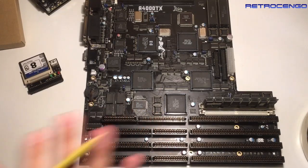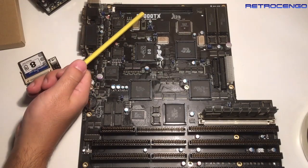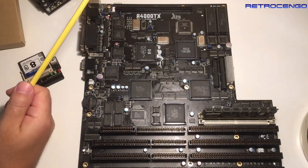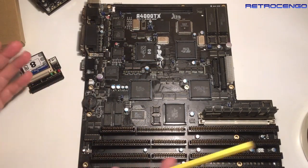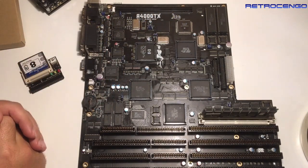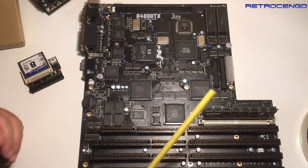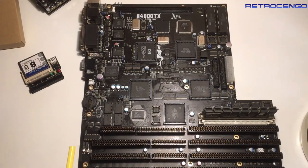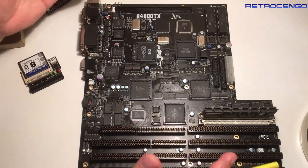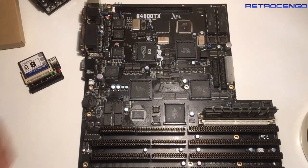I'm interested in the Amiga. And you know what, guys? I'm not going to install a Cyberstorm MK2 here with 060 processor. No way. I'm going to use the built-in 030. I'm going to enjoy this. 030 at 25 megahertz. Most of my 030 cards run at 40, 50 megahertz on my Amiga 1200s. I have also got the Warp 1260, 060 processor revision 6 at 105 megahertz. I love that one. But this is gonna be stuck. And if my friend didn't install the FPU, 40 megahertz FPU, I wouldn't miss it.